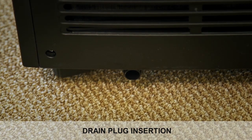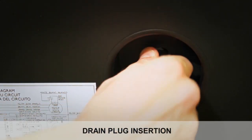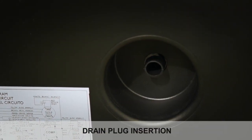To drain condensation, remove the bottom plug and connect a user-supplied drain line to the unit. When using the unit in dehumidify mode, remove the top plug and route the drain line to external drainage. The bottom plug must remain installed.